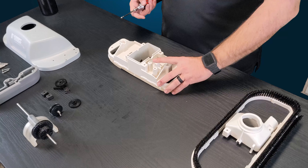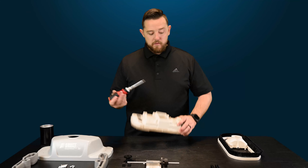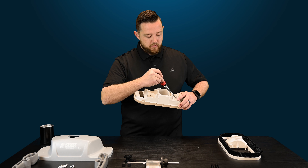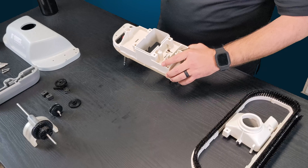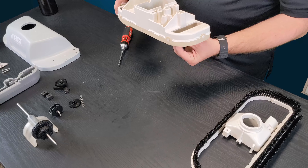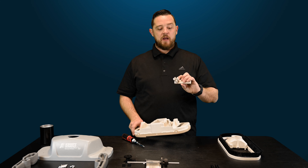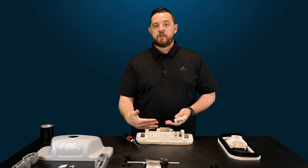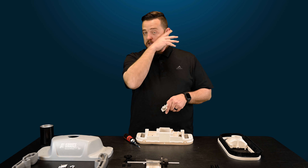The lift brush — you'll actually see a spring exposed here that you need to get access to. So in order to remove it, you will need to use something small. Get in here, kind of push down on the spring and pull the spring towards you to the point where you guys can actually see it's able to be lifted out of the assembly. So once I've actually lifted that spring out, you can tell the brush obviously does not have its spring anymore and it just kind of falls down. So in order to get it off, you're just going to kind of push it off to the side. There's a little notch in here that allows the brush, when it is in action, to not go down so far, so that way the spring doesn't actually get fully compressed and cause issues.